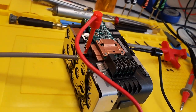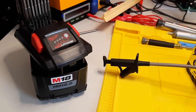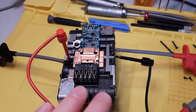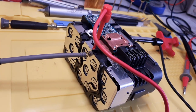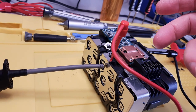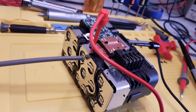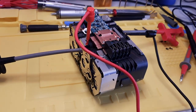For the smaller battery cells like the 4.0s and 5.0s, you can check and charge individual cells to rebalance. If you have the issue where the battery is working but you put it on the charger, it shows green but won't charge to a full 4 bars — that's a matter of the cells getting unbalanced. The charging system will charge until any of the cells reporting to it have reached the target voltage, even if other cells haven't gotten up to the target voltage. So manual rebalancing of individual cells or individual sets of cells in parallel is the answer. Alright, have a good day.